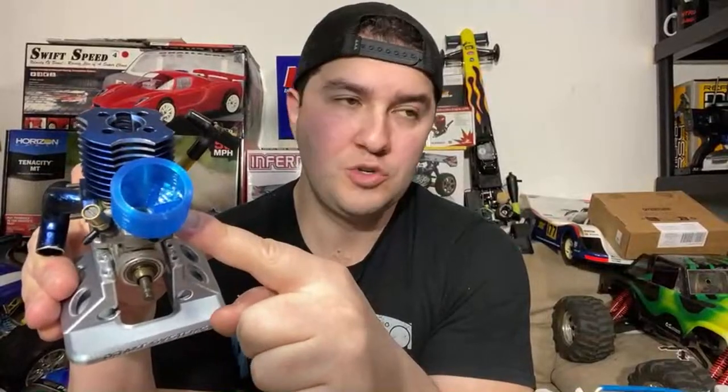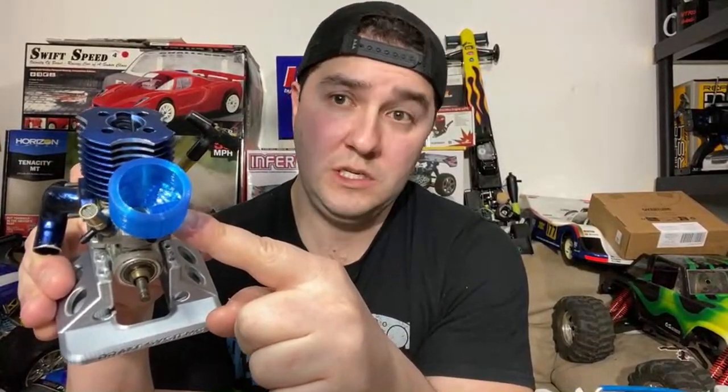Flaming Seagull says print with TPU. TPU — this is an air filter housing I printed with TPU. It's very soft, actually perfect material for air filters. Some of you might think this material will melt on the engine — it's not going to melt. TPU prints at about 240°C, which is like 500-something Fahrenheit. There's no engine that's going to get to 500°F. It's just not gonna happen.